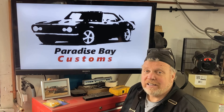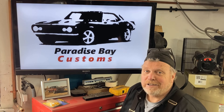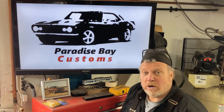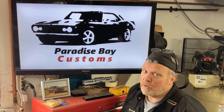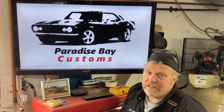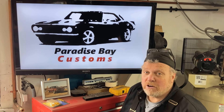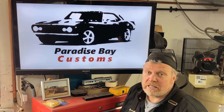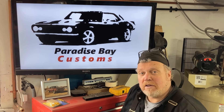Welcome back to the channel. Last video was out with the ugly, this one it's in with the pretty. We're going to pick up where we left off and start assembling the full floor, trunk, and new frame rails on the modified frame jig. We'll show how easy it is to wheel that back under in a small garage without a lift and have extreme confidence that panels are zeroed in to the proper locations. We'll test fitment, make some adjustments, and at the end of the video we'll have lessons learned and a couple nuggets of information.